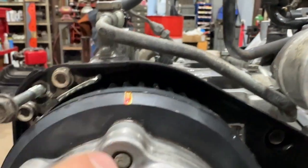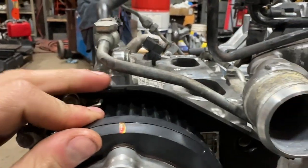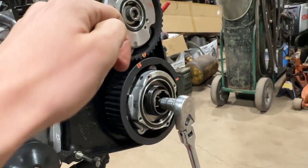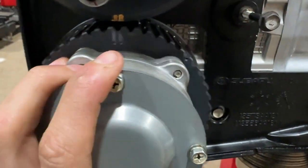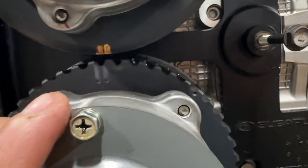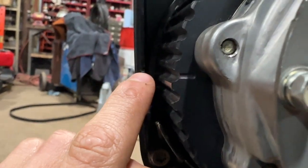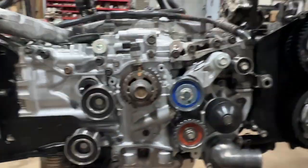To line up the cams it's pretty simple. For the top cam, a little notch on the back timing cover lines up with the notch on the cam right here. On this side, when you line it up it's going to be where the cam lobe hits on the spring so it'll be stiff to turn - annoying to line up - but the other side you can just move it with your hand. Then you're gonna line up these two notches down here, line up these two cams with each other with these two lines, and check that the notch lines up with the notch on the back timing cover as well. Do that to both sides, double check everything, then you can put the timing belt on.